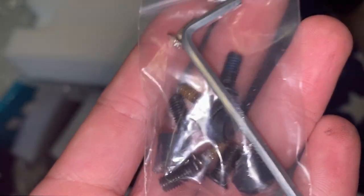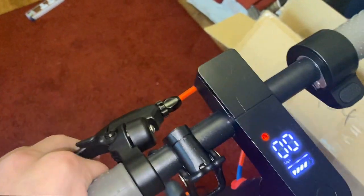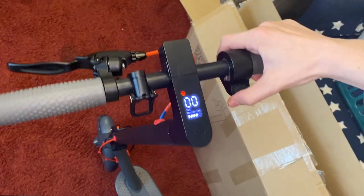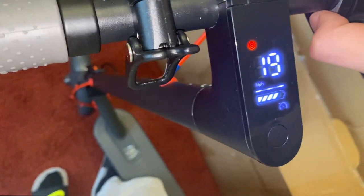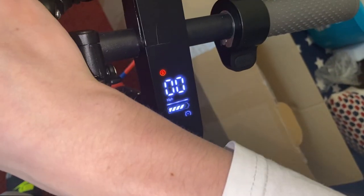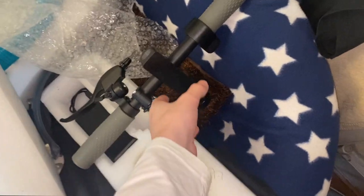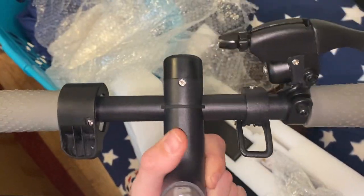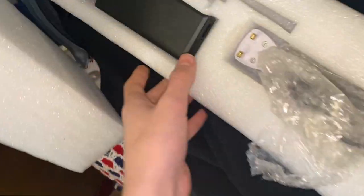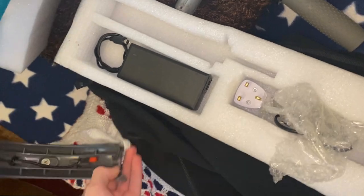Another problem was the dodgy brakes. The brakes are very low quality — the brake lever is heavy and quite hard to actuate. I had to keep readjusting the brake and eventually had to change the brake cable, which was very disappointing. Out of the box the brake lever goes straight into the handlebars, and while this is actually necessary for the front brake and regen brake to engage, the front brake doesn't engage unless the lever comes all the way in — which gives overall worse brake performance and a less responsive feel than a sharper brake setup.